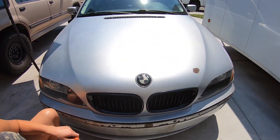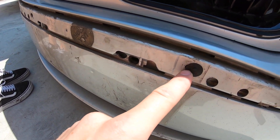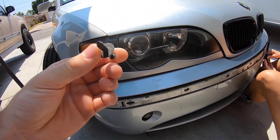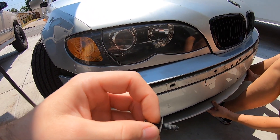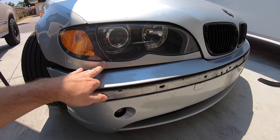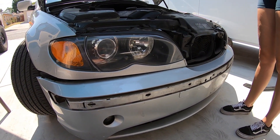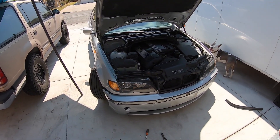In this bumper there's a bunch of push clips, but I already took them all out and only left two in so the bumper wouldn't fly off. You just have to pull the center pin out and that allows the clip to be pulled out - sometimes they're really hard and you'll rip the button right off and it's impossible to get out. From watching a YouTube video, they said you had to pull off the crash bar too, but we're not trying to do that - we're only trying to pull off the bumper.